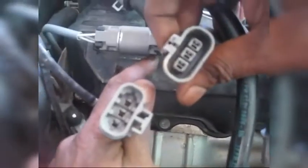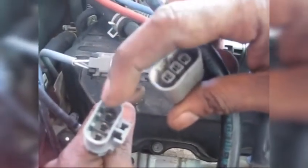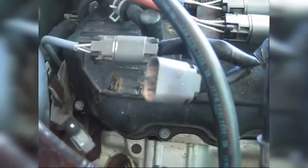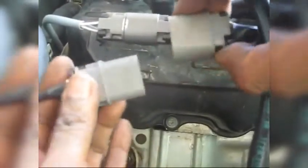When you take a look at the plug, this end is supposed to have a weather packing. Make sure the weather packing is replaced — it's a rubber seal so water does not get into our connectors.